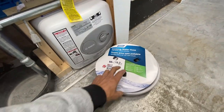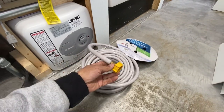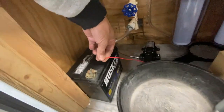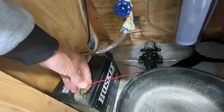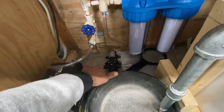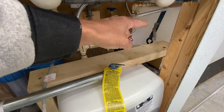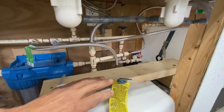Make sure you have one or two 50-foot drinking water hoses — the inspector will want to see that hose for approval to fill your tanks. To figure out which side of the pump sucks and which pushes, just hook each side into a gallon jug of water. I'm going to put a quarter tank of water in, hook up the hose, and fill up most of the water system without using the pump first.